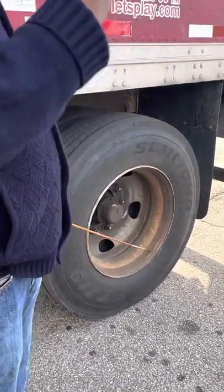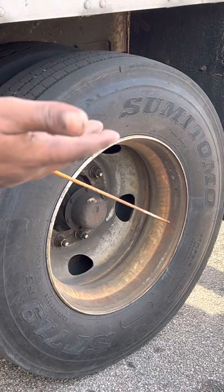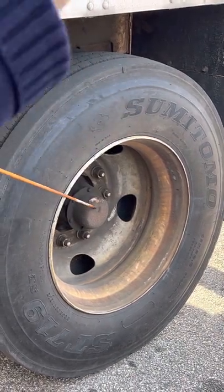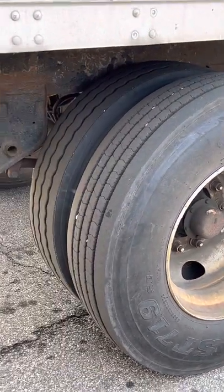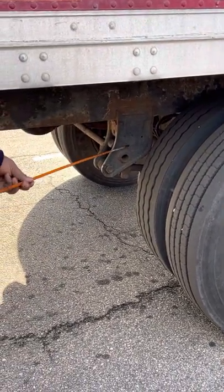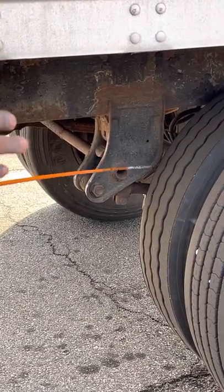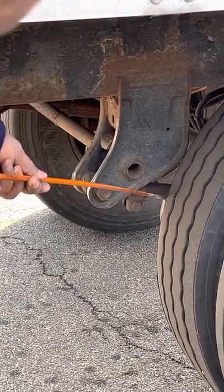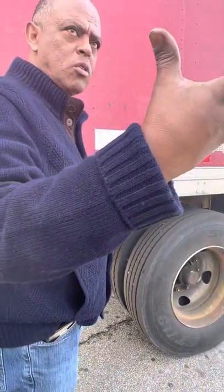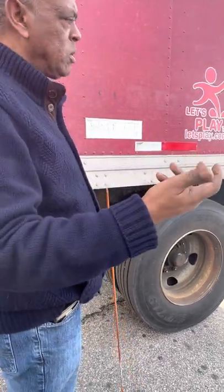We also have another rim — no cut, no crack, no damage, and also no illegally welded. We also have another lug nuts — no missing, no loose, no rust, no shine. And we also have another hub seal — all the bolts have to be tight and secure, make sure there is no sign of leaks. And we also have another spring suspension. This is mounting bracket — different kind and shape. Another mounting bracket here — no damage, and we don't have a bolt so it should be properly welded, no illegally welded. And we also have another torque rod here — no damage, no cut, no crack, no illegally welded. Another leaf spring suspension here — and you still need to check single and you still need to check as a group. And in the middle you will see the U-bolt again — you need to check that U-bolt, no damage, and make sure no missing bolts and nuts.